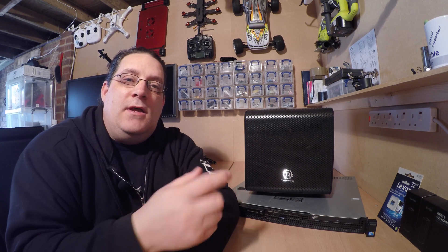Today I'm going to talk about networking — what is required. For a very basic network, even for a large number of users, it doesn't have to be complicated on the switching side. I like the D-Link web switches, which I'll put a link below. They're the best value for money and have a lot of management console configuration, with their own web interface.